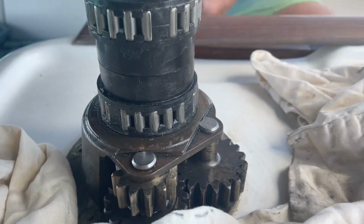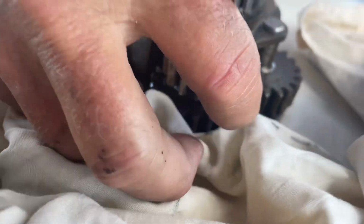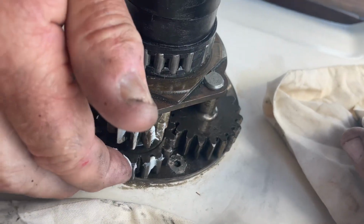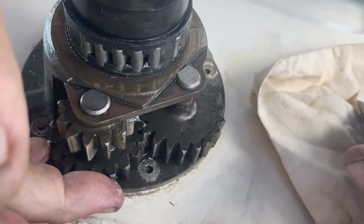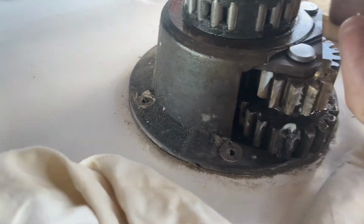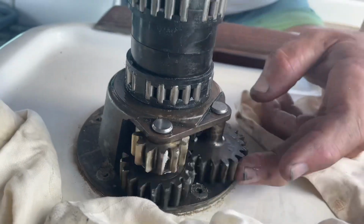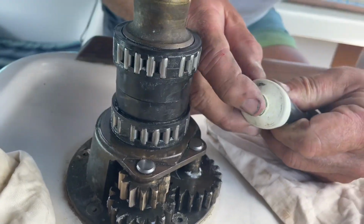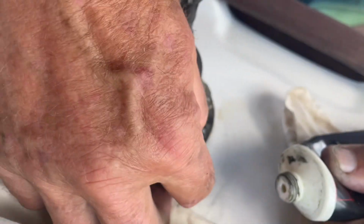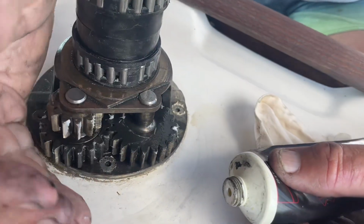All right, now we're going to get this grease out here. And this grease is for the bearings and the gears. I'm just going to, again, put a little bit on here. It'll work its way in. I don't put them in all the teeth. So it will. Turn it. There we go. Bit more here. I'm going to say it's best not to go overboard. The grease on here will then intermingle with the gear on the actual winch.